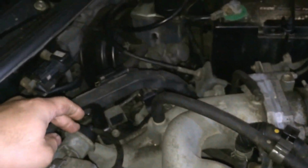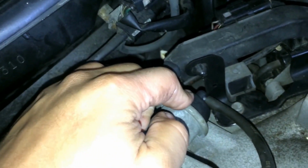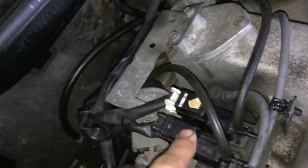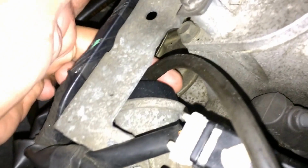These are 1/8. And a quick overview, just in case you have to take everything off. I believe this is a shutter valve. Be careful with it. This tip can break. And again, just follow it. It comes to this solenoid. Connector is white. Same thing here, another solenoid. Connector is black, and it goes to this guy right here. It's another shutter valve. Basically, you're going to remove the harnesses out.